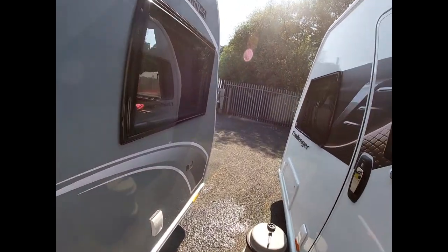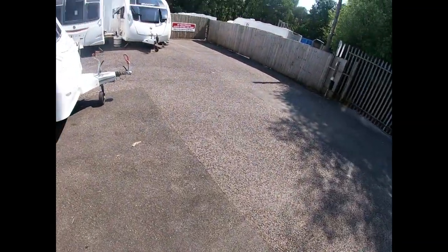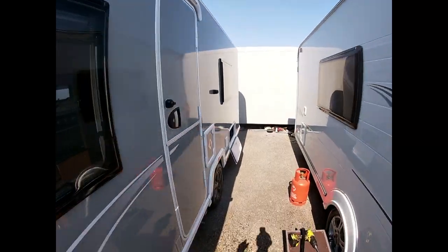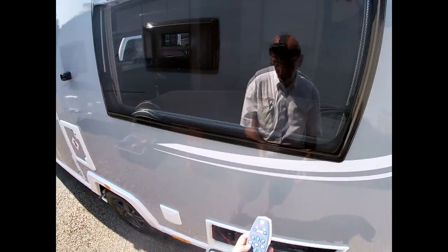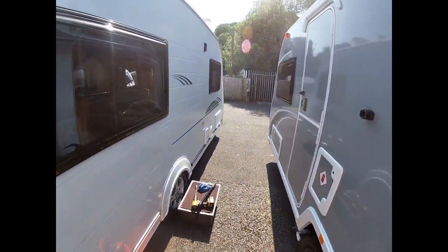Once you've finished with it, you've got it in the position you want it, the first thing you need to do, before you forget, is put the handbrake on like so. That will stop it moving anywhere when I disconnect the rollers from the tyres. Switch off my handset by pressing one of the green buttons like so. Removing my motor mover isolating key from there.